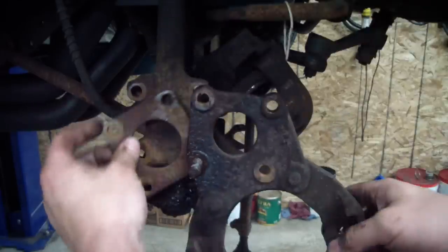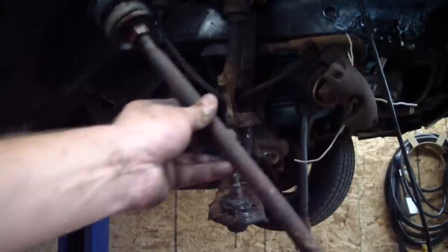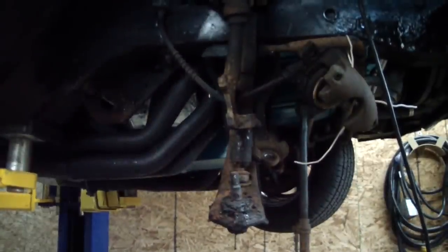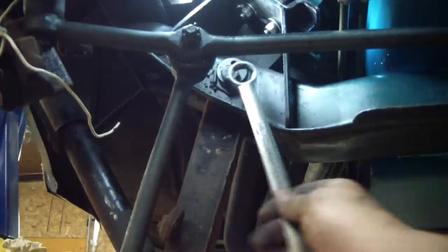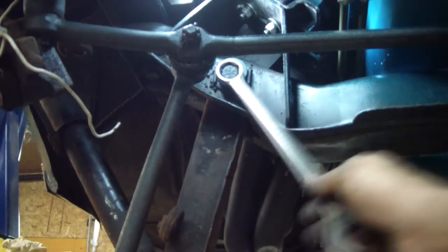Here's the caliper bracket coming off with a couple of spacers behind it. Here I've taken this rod off and I've separated — I believe it's called the trunnion — from the lower control arm with the pickle fork at that ball joint there. I've loosened the two bolts and I'm getting ready to take that out. I'm taking the lower control arm off now by removing this bolt, and you can see with the cam on there that that is their camber adjustment.